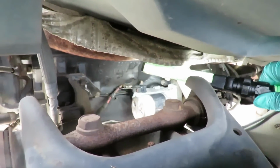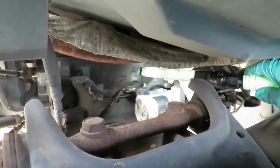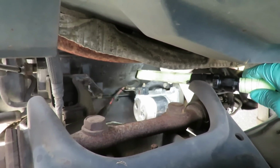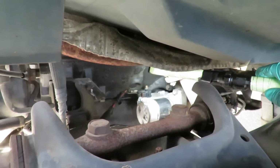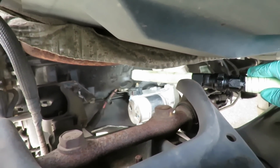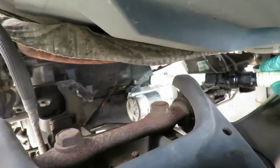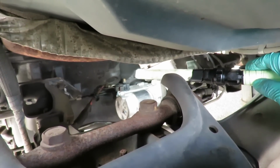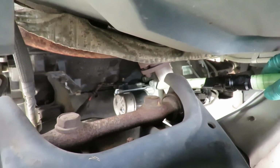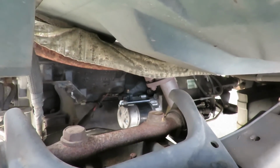And what I want to look at first is, I'm looking at the power wire that's going directly to the battery. Man, they put that right close to the block. But if I can reach over there with a voltmeter, or better yet, you know what I'm gonna do, guys? I'm gonna get my jumping cables, I'm gonna put a ground on the starter and a ground on the battery, and then we're gonna try it again. All right, be right back.